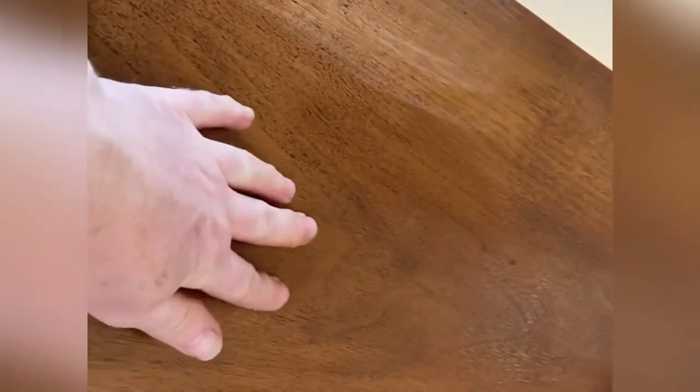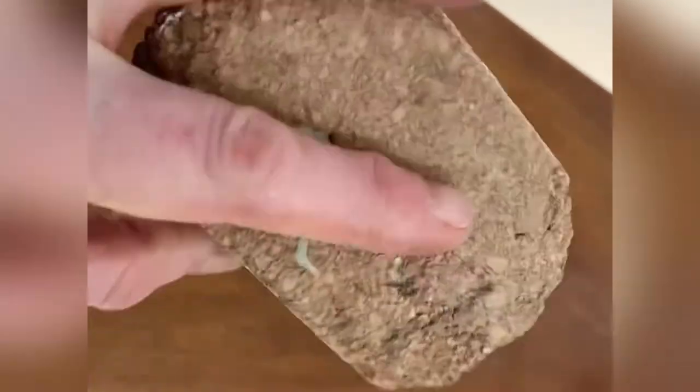When you come into key sanding, two things I think you need to just make sure of. One is that you're not using grit that is too high. I usually do a key sand with a 240. You're just trying to rough up the surface so that the paint can stick to it. And the second thing is, oh, these are your best friends.